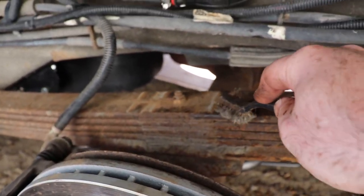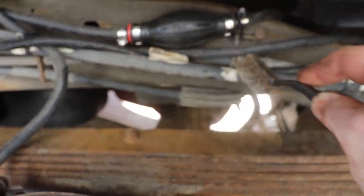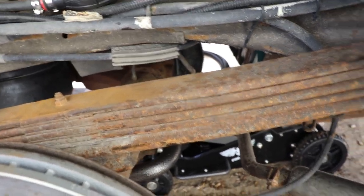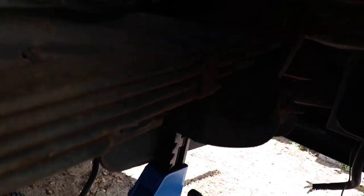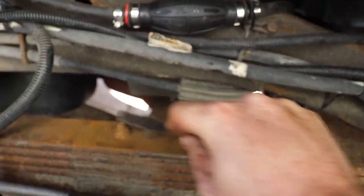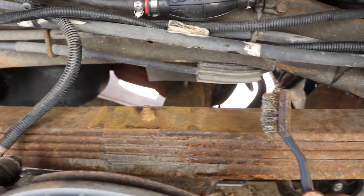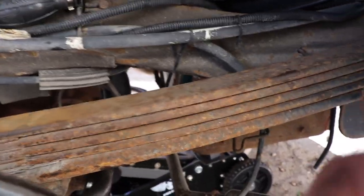Just waiting for the hardware paint to dry and cleaning off the tops of the leaf pack. If you were doing the overload springs you'd be taking off this big one on the bottom and putting two upside-down leafs on. If you were replacing the leaf packs altogether there is a procedure for setting up the rear shackles — you need to have them in the right position when you torque them down so that your van's not leaning to one direction or another. That's in the Chilton manual I'll reference.